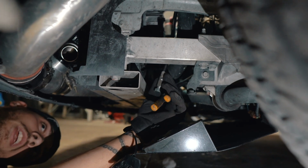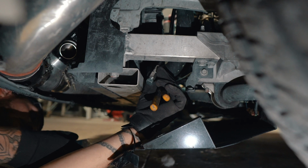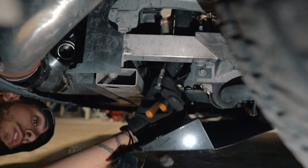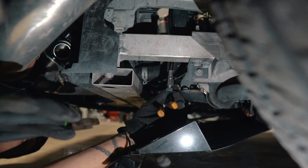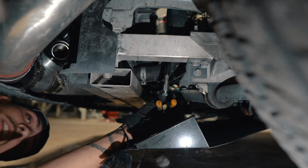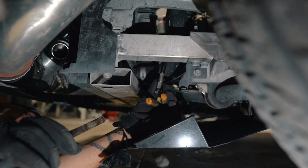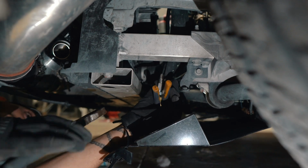All right, so normally when I go about emptying out this oil drain line, I use a water bottle, and we just had one laying around. There's not really much oil in this supercharger. There's only about 4 ounces of oil, or like 4 ounces of oil exactly. I'll go over that in a minute. That's a really crucial point about this oil change, is the fact that you need a very specific amount of oil in the self-contained unit.